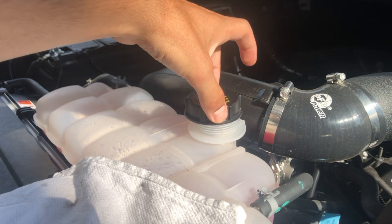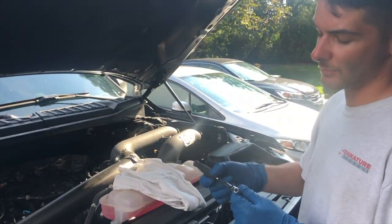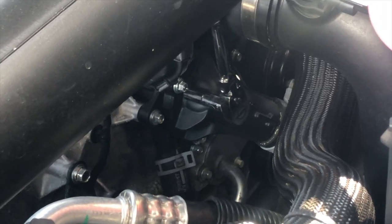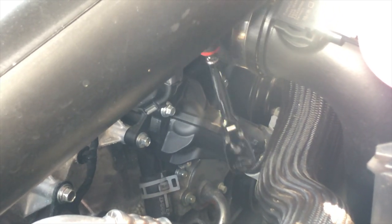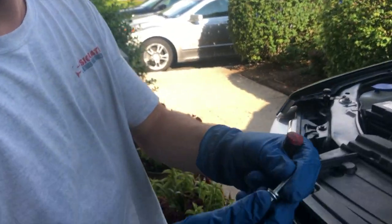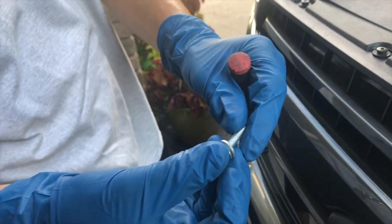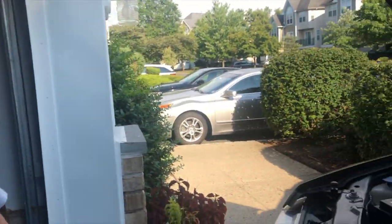Right now I'm going to go down — there are three 8mm bolts holding the housing in, so we'll just loosen those up. There's one right there, one below it down here, and then one on the other side. This is pretty much what the three bolts look like with the washer too — it shouldn't fall off but just make sure to get all of it together.